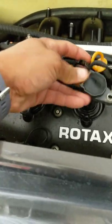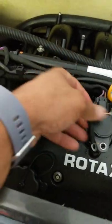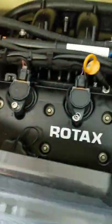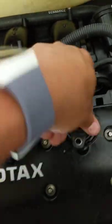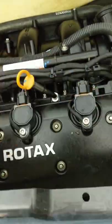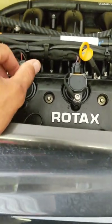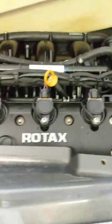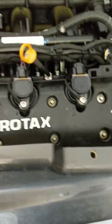If you're new to this, one of the things you're going to want to do before you put the ignition module back is plug it in first, then go ahead and seat it all the way — make sure you hear the snap — and flip the ground wire back over. Press it down and set it in place. Things tend to sit where they used to be, which is a good indicator of how to put everything back. Set the camera down, double-check all the seats on the ignition module, use two hands, start all back in with a little blue Loctite, and torque down to spec.